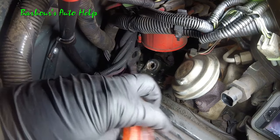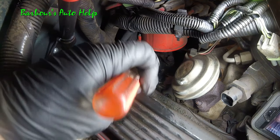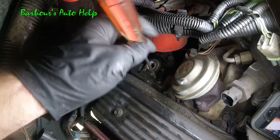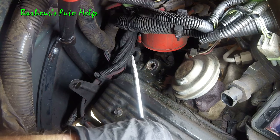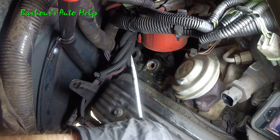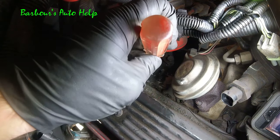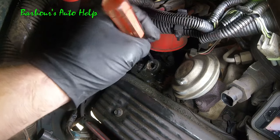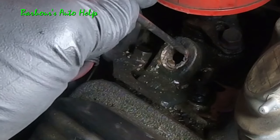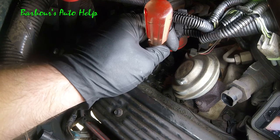Now I'm going to use a screwdriver as a punch. A screwdriver is not a punch — I know some people are going to give me flack about that — but I think a screwdriver works better than a chisel because the tip is a little bit skinnier. A chisel is more blunt on the end, and I feel like this can really get in between the surface of the intake and the broke-off piece better. Be sure you're wearing safety glasses. I'm going to take the tip and put it in between the outside edge of that broke-off piece and the intake manifold, and just gently tap on it.